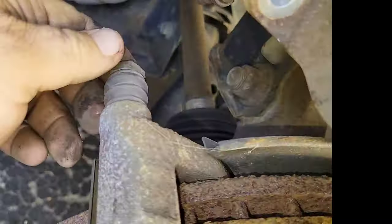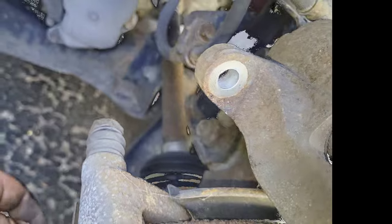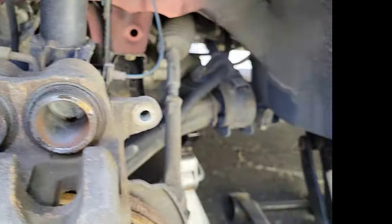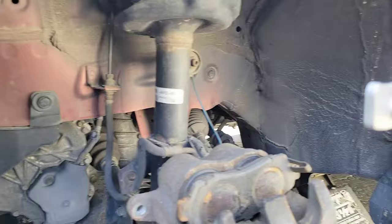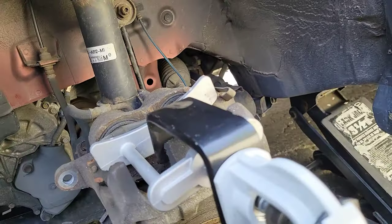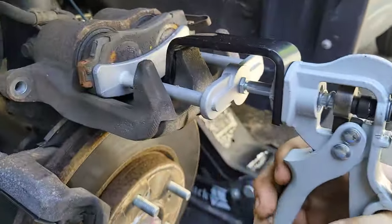Once you have them back in, push down, make sure they're going in nice and neat — which they are. We've got to push this caliper back in. I did have a tool — got my little nifty caliper press. We've got our old brake pad up there; I think we just set it over like this and start pumping.